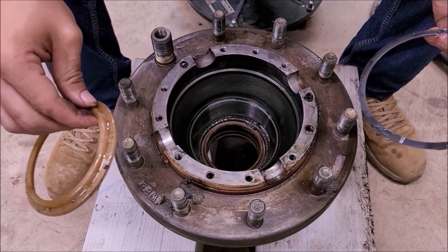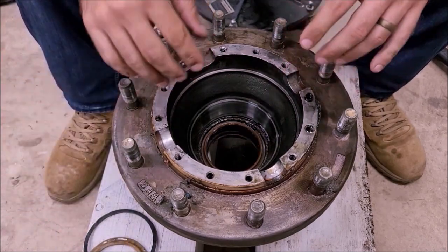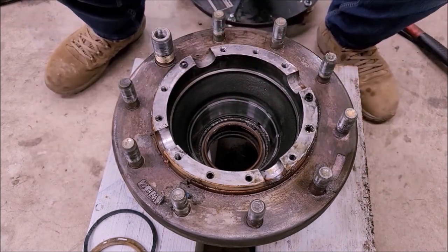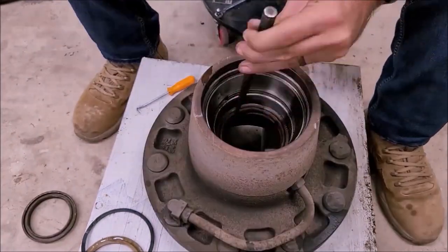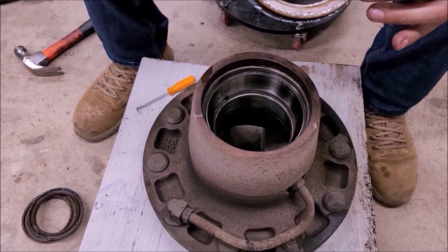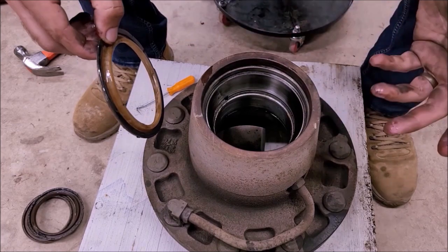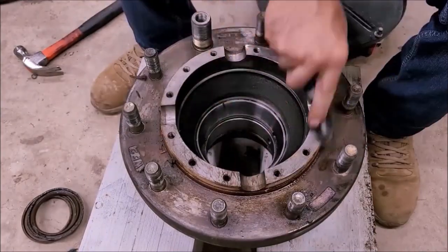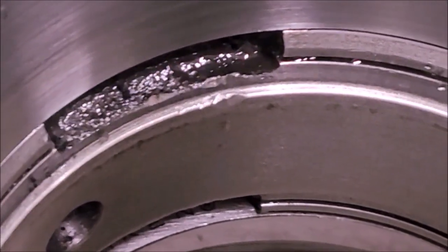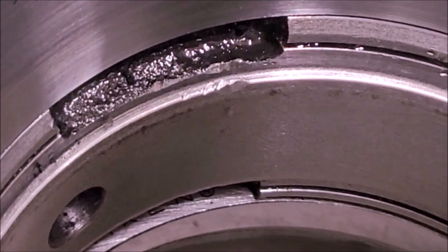More RTV in there. Since I don't have something really good to pull with force, I'm just going to use a regular punch since I'm not concerned about damaging the seals. I'm going to punch from this side to punch the other side out, then flip it and vice versa so I can clean it. Got those out — these you're going to want to save. I did buy some spare of these plastic pieces in case I found them cracked, but these look like they're in good shape, so I'll probably just reuse them. Now it's just going to be cleaning up everything in here. Got everything cleaned up and the only thing I see of concern is at some point looks like somebody replaced the races for the bearings in here — there's a couple nicks but they don't seem terrible.